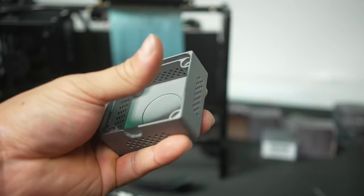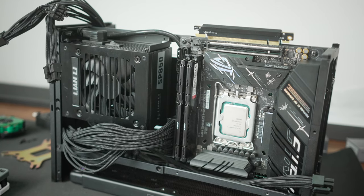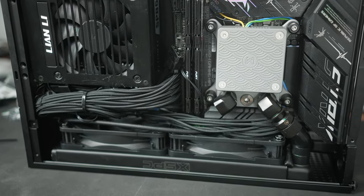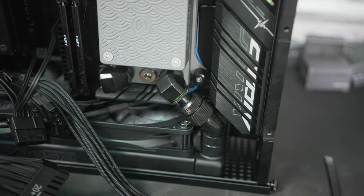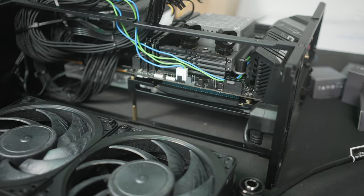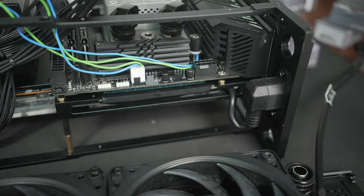It's a pretty low unit, which gets us to the second consideration: how much space you need to give the motherboard side of the sandwich. Initially I started the build with the absolute minimum and it seemed like it would work, until I actually popped in the 90-degree rotary fittings I'm using here — the Glacier fittings that Fantec sent by, big thanks to them. These are really high quality, but they just pushed out on the side panel when I tried it. So I did have to give it another five millimeters. What you're seeing here is the divider shifted in five millimeters from the absolute minimum. I also shifted the motherboard standoffs out by roughly three millimeters, because this pump block has a really thick back plate and with the riser cable and power cable passing through around the back, it was just a better idea to relax that fit a little bit.